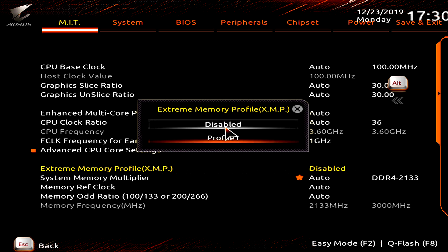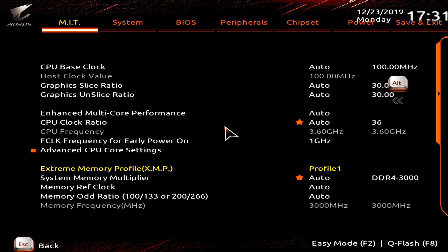2133 MHz is the default speed for DDR4 RAM. What a lot of people don't realize is that when you buy RAM rated at, say, 3000 or 3200 MHz, it's actually overclocked — DDR4 spec is 2133 MHz and anything over that is technically an overclock. Manufacturers test their RAM to that overclock frequency with the specified timings and sell it as such. If you don't select this in your motherboard, it will run a lot slower than you expected. So even if you're not overclocking, always load your Extreme Memory Profile. We'll set that to Profile 1 — you can see my speed is now set to 3000 MHz. Gigabyte motherboards do a really good job with automatic voltages for memory, so no manual voltage adjustments needed here.